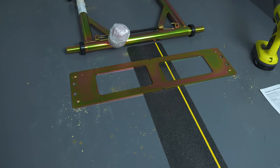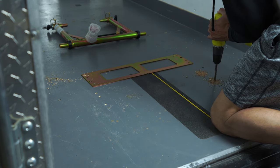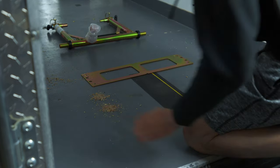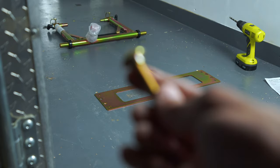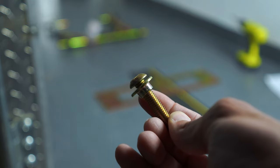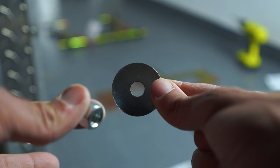Once you have your measurements done, go ahead and drill your holes. Grab your bolt and then your mushroom standoff with the flat portion up at the top of the head, then grab your flat washer and your nut — those go on the bottom of the trailer.